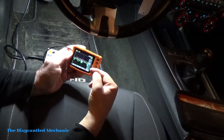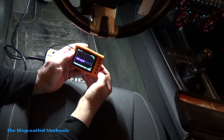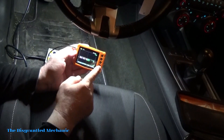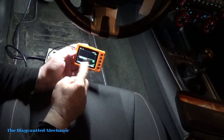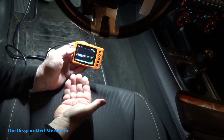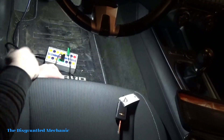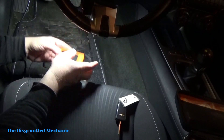So we're on menu, hit OK, go down to presets, hit OK, sensors, and then go to CAN low, hit OK and hold. Now we're on CAN low. You can see my reference is now showing the proper signal. I knew that something was wrong because the reference was showing the wrong way. All I did was forget to put the scope to CAN low — I went into the settings and put it to CAN low, so now it's reading the CAN low signal correctly.